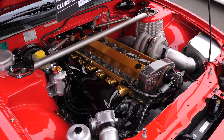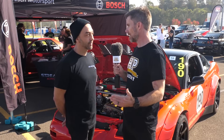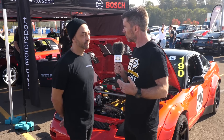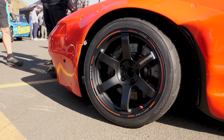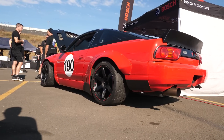However the car is being used for circuit racing as well. Is there a downside in terms of the weight balance? The RB physically is a large, long engine and it's a cast iron block so it's also heavier than an SR. There's definitely a disadvantage having the RB engine, it's definitely heavier. We can feel the weight in it but I'm trying to trick that by putting 295 rubber on the front. Builds in suspension all around by DNA, so it's definitely helped me go around corners.